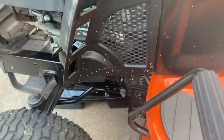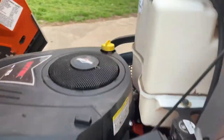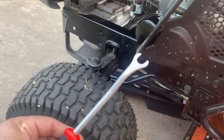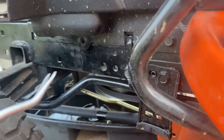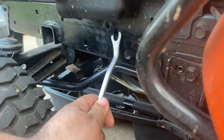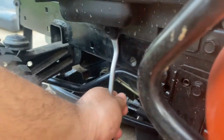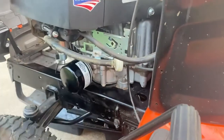Before you start changing your oil, you're going to have to take these two plastic pieces off — there's one on this side, there's one on the other side. It's pretty simple. You just got to get one of these tools right here. I got these from Harbor Freight. It's for taking panels off inside the car's interior. There's a little clip right there, and if you get up under here, pry that off, and then this piece slides up and comes off.